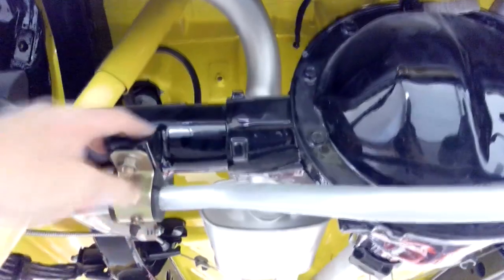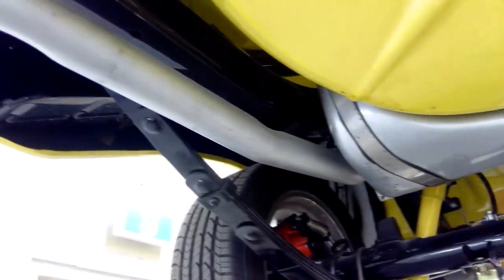With the 3.23 gearing it's got good highway legs for road trips. We welded brackets for the sway bar rather than going with U-bolts over top, so everything bolts on clean. We've also extended the frame work back here — you can see a few holes for a trailer mount, with plates inside and threaded nuts, so it bolts right in. You're bolting into at least half an inch of metal — a little overkill, but solid.